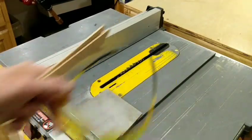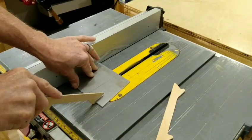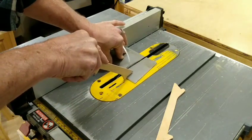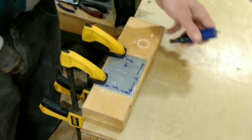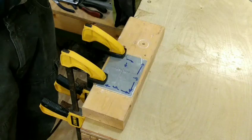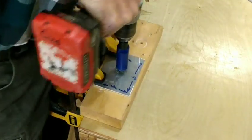Make sure you put these on - do not do this without eye protection. My little plate is three by four inches and I'm just going to use this hole saw I picked up at the lumber yard. I'm going to drill a one-inch hole using my cordless drill. I could use a drill press but I don't think we need to be that fancy.